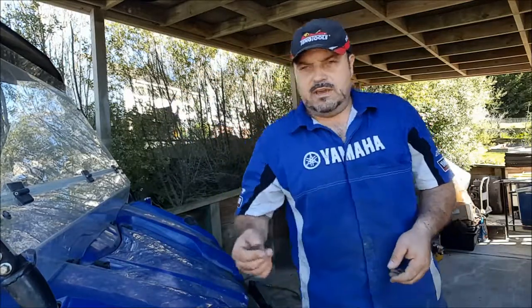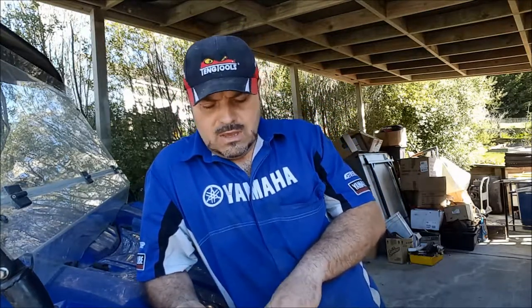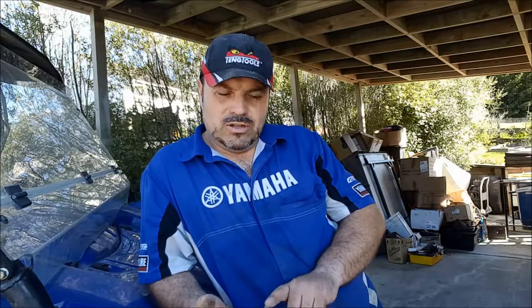Great stuff. Okay, so what you've not seen on camera is we replaced the rear brake hose and bled the rear brake system up again. That was a previous task where we spotted, whilst doing the calipers, some damage on the rear brake hose, the flexi hose. That's the one that runs right across the back of the vehicle. So that's now been changed and we've bled the brakes up again. Didn't see any point in doing a video for that. I'm sure you know how to change a brake hose.